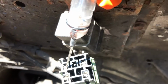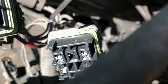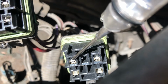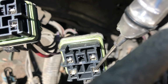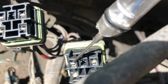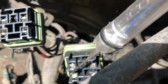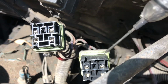As you can see. No, sorry, this plug is for the starter, this plug for the injector. So sorry, this one, the bottom. Right here, this one is power from the battery. This is the supply for the starter. This one is ground, straight ground, and this one is a starter signal with positive. So when you put the ignition switch on, you have ground here, power direct right there, and when you push the starter button, you will have power right here. So ground and power go to the connection from the battery supply to the starter solenoid. So you see they look different.